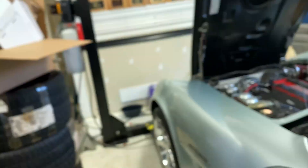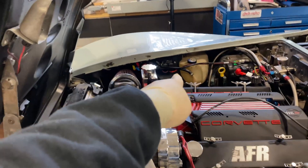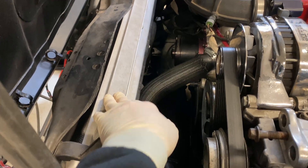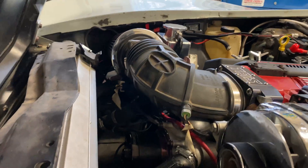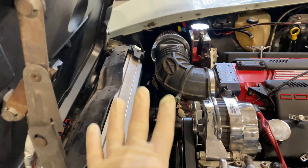So this is a combination of an 82 C3 and an LT1. The LT1 cooling system is a bit different, not a lot different. What I ended up having to do is put an expansion tank in, because you couldn't see how the hose dips, and it was very difficult to do a venting because the radiator is higher than the filler neck. Now the expansion tank is the highest point, and that made a world of difference and much easier to vent. The cooling system is working fine.